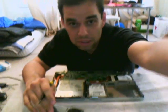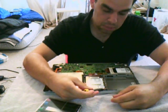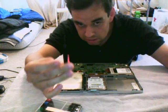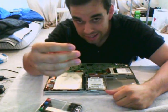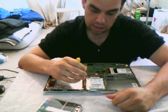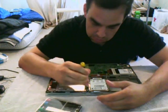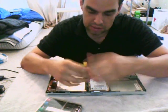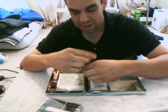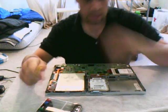You may look it up on the net and people may tell you differently, but this is what works for me. There's one little black screw towards the front of the machine — unscrew that. What's great is it only takes one size screwdriver, so once you have the T8 you're good. I also remove the two silver screws on your left-hand side. I do this because there are rubber grommets holding the drive in, and if you remove this section and the plastic piece associated with it, you don't have to fight with the grommets as much. Take this piece off and don't lose it.